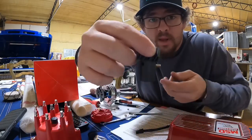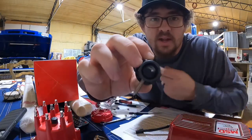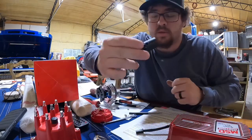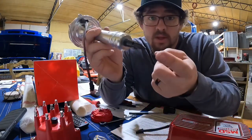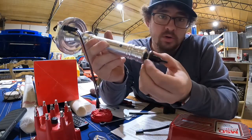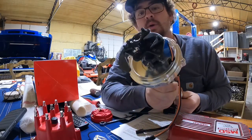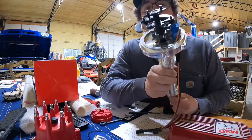We drove the roll pin out all the way to where it's just barely in here. As you can see, that's the collar that slides over the oil pump — that is what drives the oil pump right there. There are washers down here — make sure those don't come off. Now as you can see we're going to lift that up, and all that sprung apart.